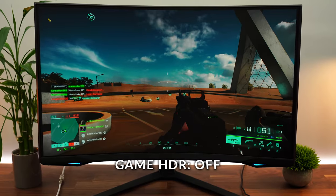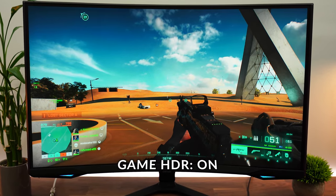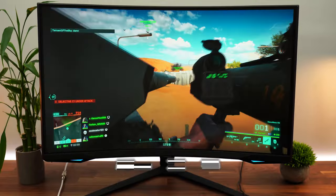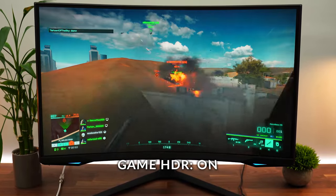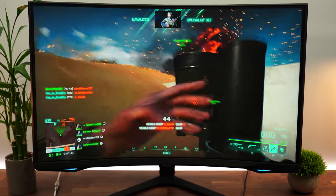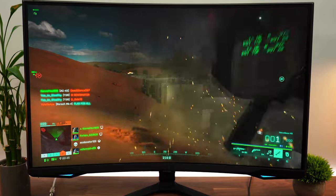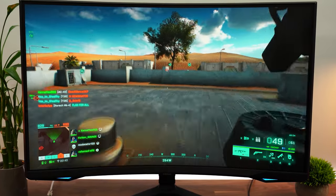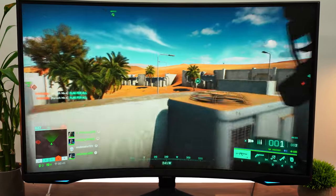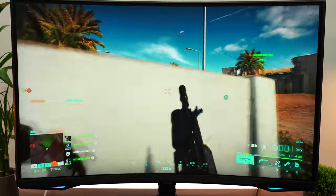Highlights do not pop out of the screen with game HDR off. When you flip it into game HDR, it way bumps up the brightness — similar to that SDR brightness of 410 nits and above in highlights. However, it's also not tuned really well, as it does blow out a lot of sections of the screen. Without game HDR on, you have no sections blown out — it handles everything well, but it's not very bright.